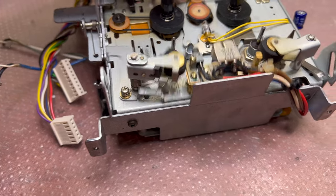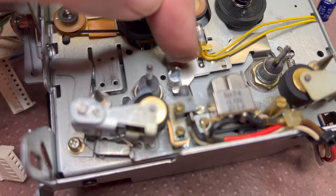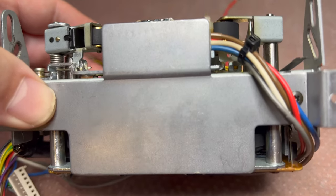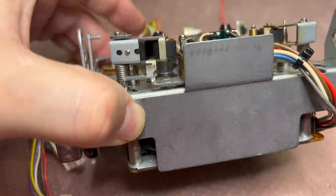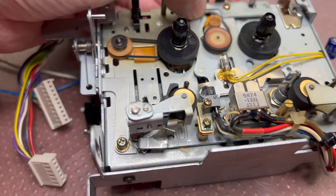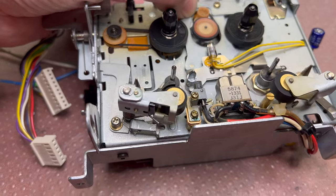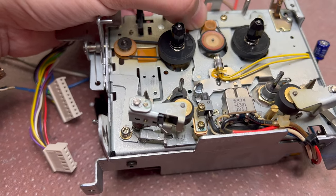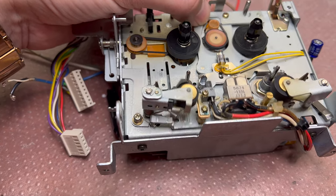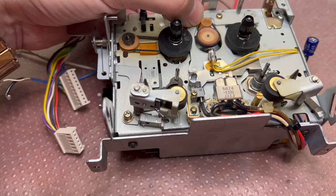The housing goes in pretty easily and smoothly. Here we have a ball from the top and balls from the bottom — I believe three balls on the bottom and one ball on the top. That's how the head base moves and holds its position. The head carriage will always get to the tape in the same position, and it's very easy to operate with everything rolling and moving smoothly. Let me apply new lubricant to the balls.